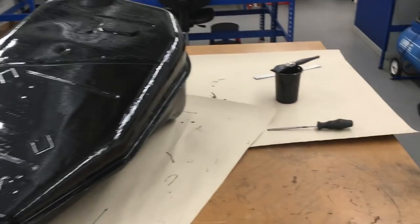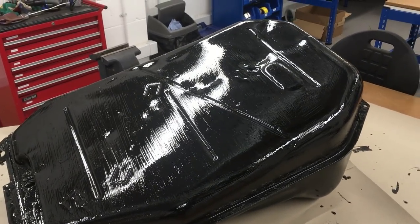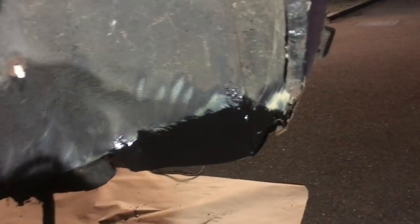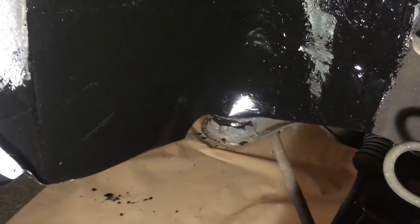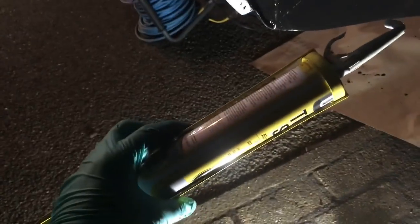Fuel tank done. I've still got quite a lot of paint left in the pot, so I went back to the car - I've actually pretty much painted everything that needed to be black, so that dregs of paint I'm just going to have to throw away, which is a bit of a waste. Never mind - I've got another 70 quid's worth in a drum. Next I'm going to put some seam sealer on some of the seams, particularly that one up in there, same on the other side, and maybe another couple of little water traps like behind the inner wings.